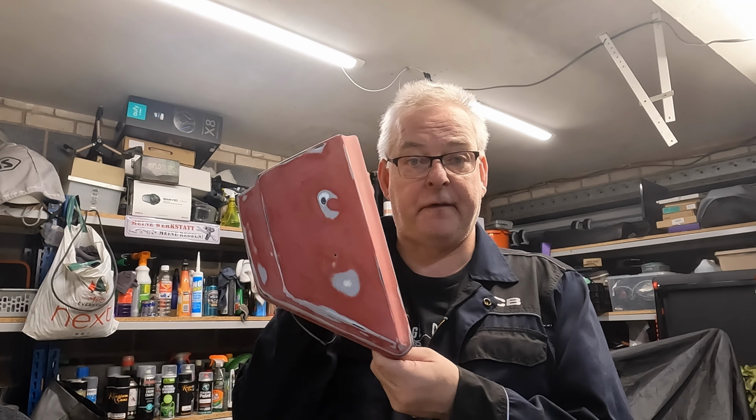Okay, so I've done it with some very fine sandpaper. I've also used one of the abrasive pads just to really make sure it's smooth. Now, I haven't taken all the paint off. I don't think it's original paint on these side panels because it came off rather too easily. So there might be an issue with a reaction with the primer that I'm going to use. It is a 1K primer, so I don't know. We'll just have to have a look.